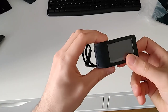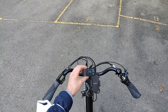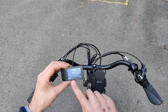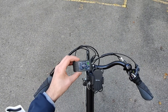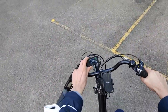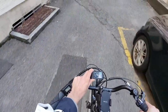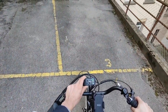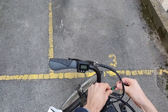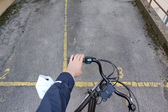Unfortunately, all those thoughts existed only in my head. Once I connected the display to the bike's controller, I soon got an apparently famous Error 30. This error basically represents an issue with the speedometer, which I soon realized was not present on this bike - most likely it is integrated in the hub motor itself, making this display perfectly useless for my intended purposes. Not too bad though, since I like it a lot - I'll just use it on my 750-watt Bafang build.